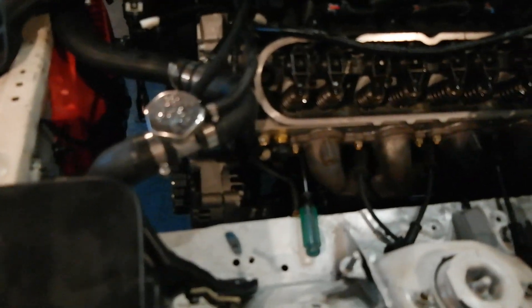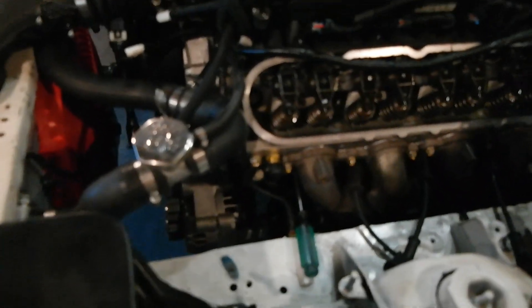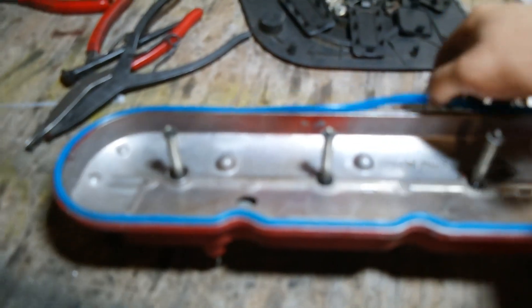You never know though. What I'm doing right now is definitely a lot easier than pulling all that and then the oil pan bolts — that's a whole lot to go through to check the timing. It's sealed up right now. If you've ever done an oil pan gasket or timing cover on these LS motors, or LTs, even the older Chevys — they love to leak from the front. So I got it sealed and it's not leaking at all. But on another note, we got a good old high quality Felpro gasket, brand new, that's been run for not very long and it already doesn't want to go back in — it wants to bubble up. So I love me some Felpro, right?